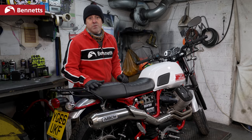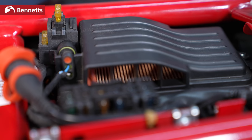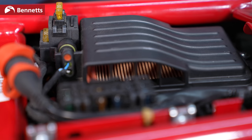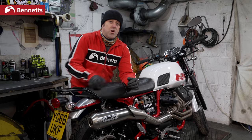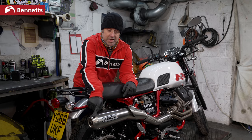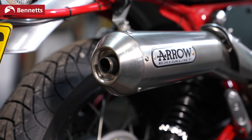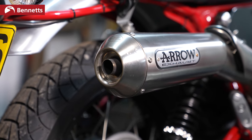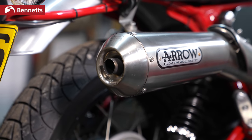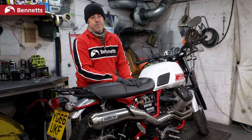I've known scenarios where people have checked their airbox after 6 months and there's been a hamster or a mouse or other living animal in there. So check that, get your airbox checked. Don't forget the blow side. You've got suck, squeeze, bang, blow. Is the exhaust clear? Some people put bungs over the exhaust to stop condensation and corrosion. Some people put a rag on the end. Some people find their kids' toy cars or whatever down the exhaust. Just make sure that is clear and the air can leave the bike, and check the airbox is fine so air can enter the bike.